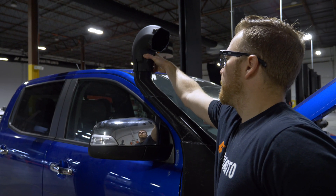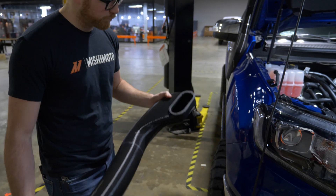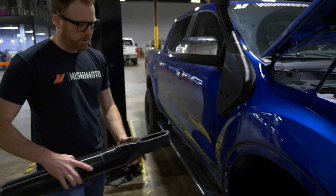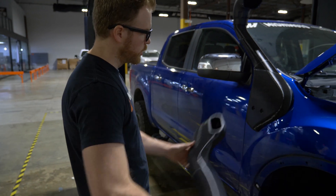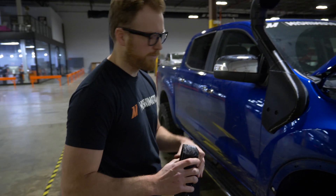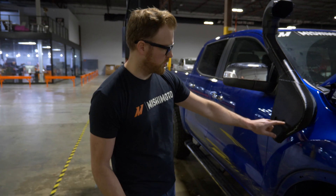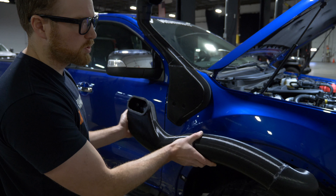This is the other portion of your snorkel. This is going to run along the inside of your fender. There are two lugs inside of here, and there'll be two bolts that pass through the outside. Now, it's really hard to support this side inside the wheel arch — there's not a lot of room, so you can't really have locking tabs and all that. To prevent you from having to fish your hands around inside of there to put on hardware, you simply tighten up these bolts and that's going to snug this side in and keep it locked in a rigid place.